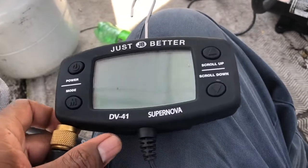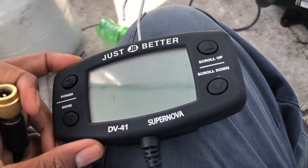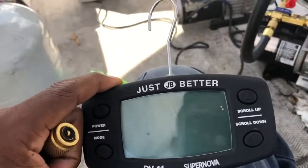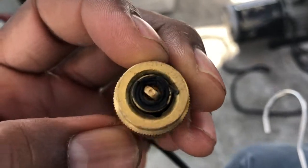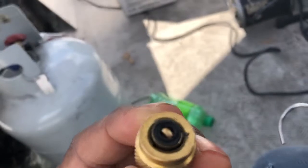What's up YouTube family, this is Jeff with Little Bit Everything On Services coming to you with another video. I just want to bring something to your attention for those of you watching: if you have a micron gauge that's acting up, going up and down in pressure, one thing you want to check is the o-ring. As you can see, I had this problem with this one and the o-ring is just chewed up.